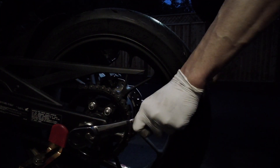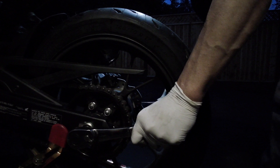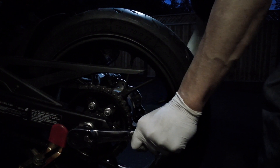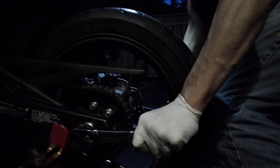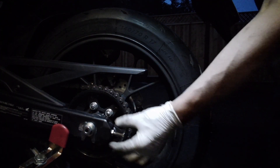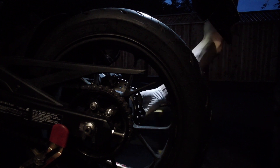This side is 19mm and the other side is 24mm. I'll push the wheel forward so it's nice and square with the centerline. The torque on this should be about 60Nm or so. Let's see how loose it is now — this cap is tight, which is good. When you don't push the wheel forward this cap is still loose and jiggles, meaning you didn't quite do it right. Both sides are good.